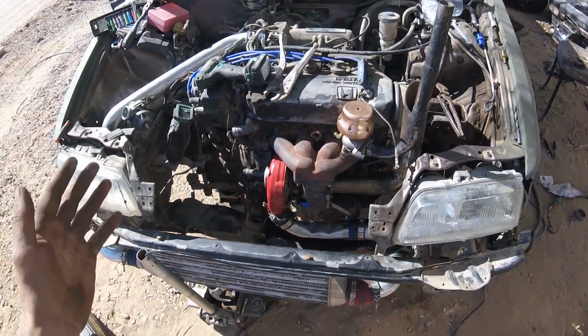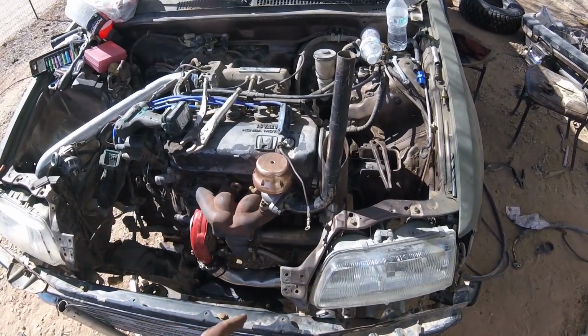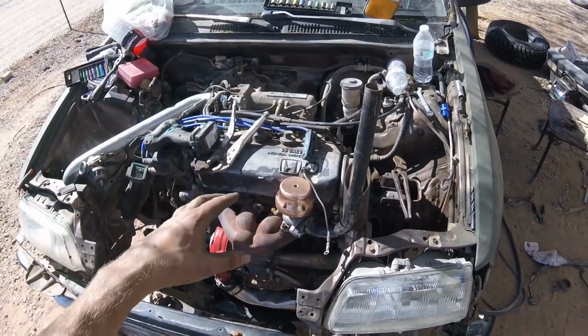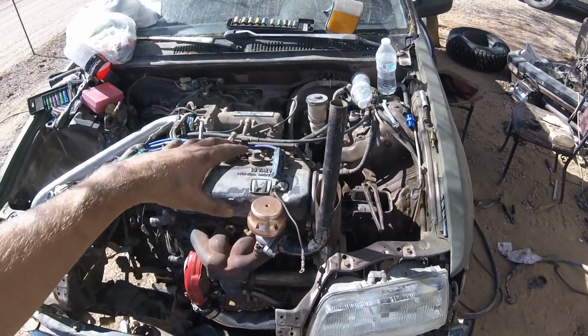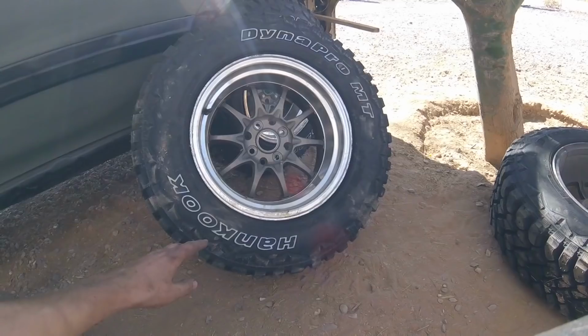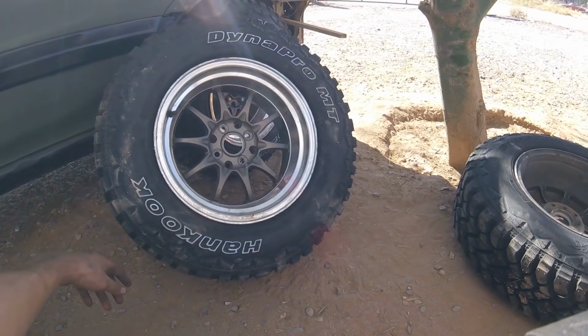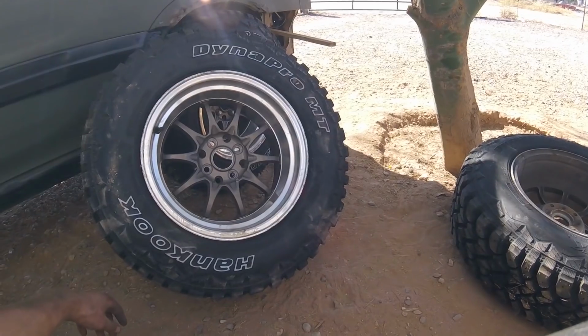It's pretty much done. I've just got to put the radiator and all that back in. I've got to cut the hood to make it fit, and I'll probably just run 4 hood pins, so that way I don't have to cut too big of a hole, and the hood will just sit over it, and then I can just pull the 4 pins and take the hood off. But it's all basic stuff. The next video is gonna be raising the car up and getting these massive tires to fit.